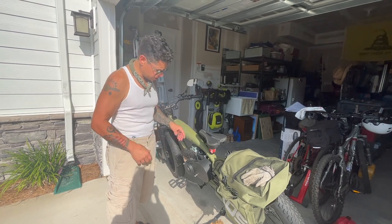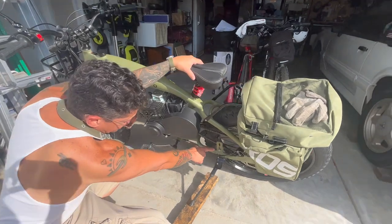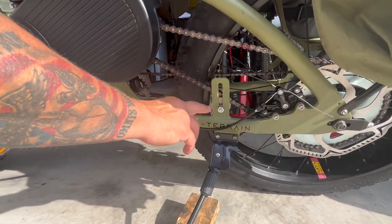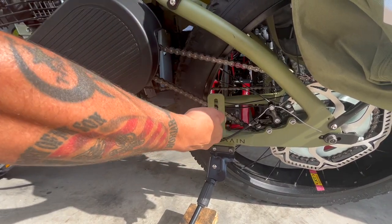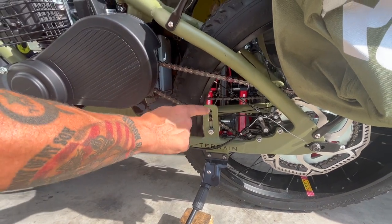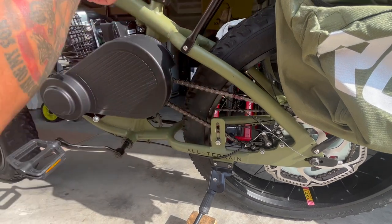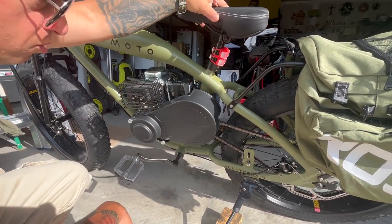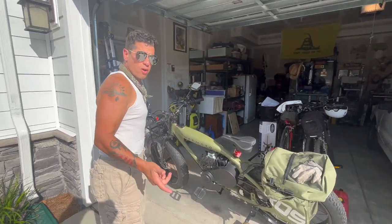The tension wheel is a little bit off — you can't see it from this angle — and at some point I would either use a scrub pad like for a timing belt or bend this bracket, because it's not dead-on parallel. There's a little rubbing. I added grease — you definitely have to add a high-temp grease to this chain and the primary chain behind this cover.